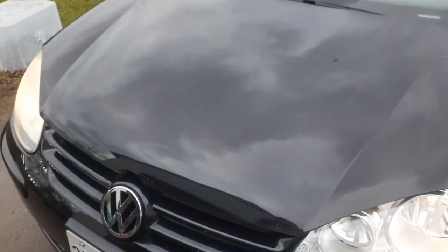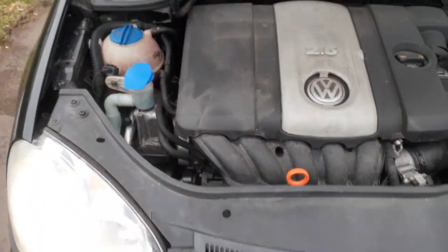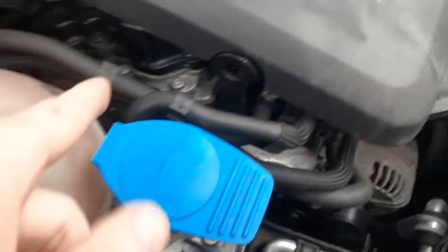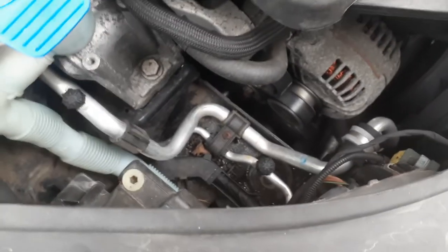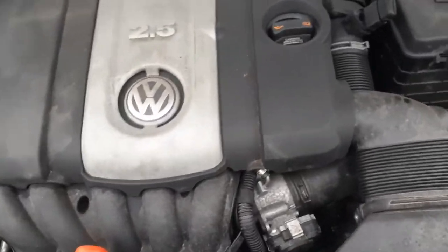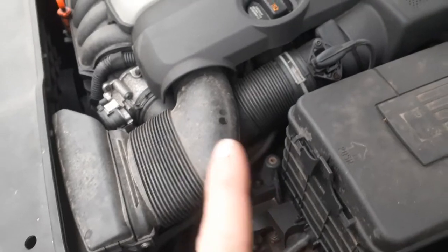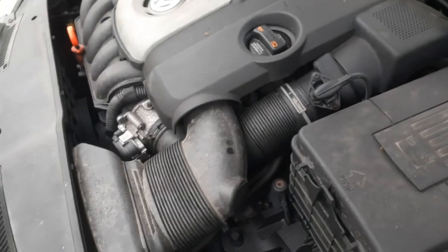But anyway, start it up, let it warm up before you do your oil change. You don't want to do a cold oil change. You don't want it hot, but might have to crank down the seal a little bit there. You definitely don't want a hot oil change, you can get burnt, but do a little warm and then the oil will come out, because if the oil is old in a car, it gets thicker and it won't drain as good. So warm your engine up.